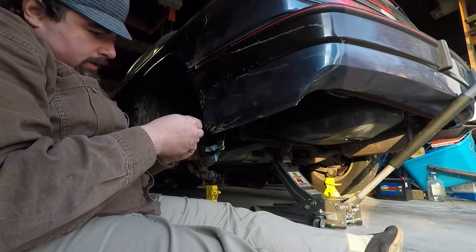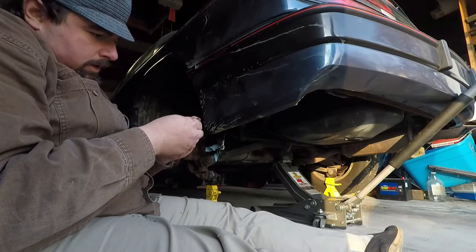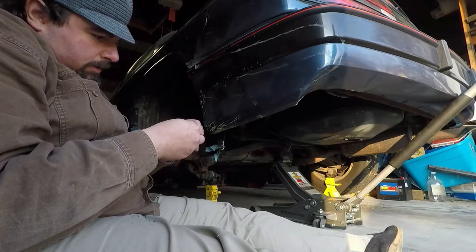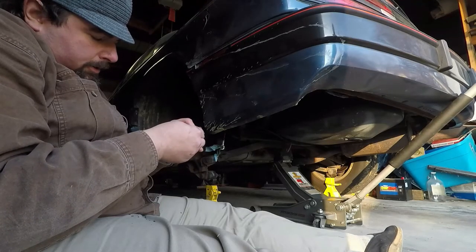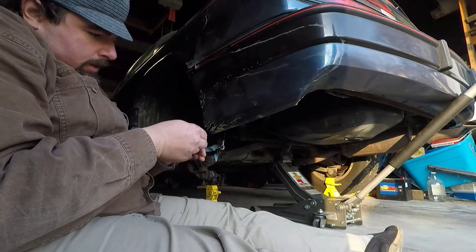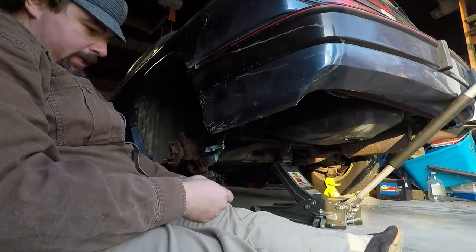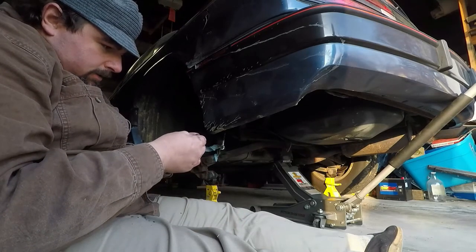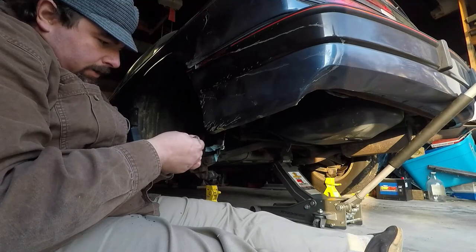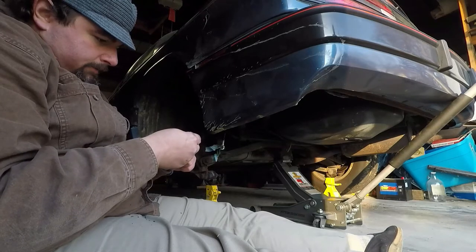It's just 25 years of Loctite. Yeah. It's things you do, you should use Loctite to help keep it from backing out, because this is the vibration part. Loctite holds the bolt, but it also helps keep the bolt from rusting in place. True. Unless you just don't use red Loctite unless you never want that bolt to ever come out again. Or you work in a Fiat factory making Jeep Renegades, apparently.